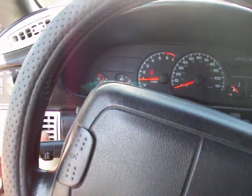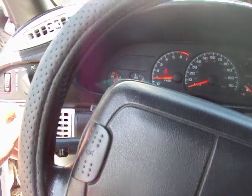You want it right around 40 pounds of pressure — between about 25 and 55. Higher and in the middle is best. If it's too low, the pressure sensor is not going to let the clutch kick in for the compressor. And if it's too high, you can damage your parts. Just make sure that your pressure is at a good stable level and high enough where there's liquid in it, and you will have ice cold air.